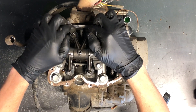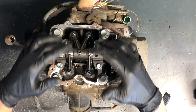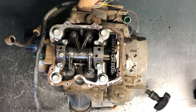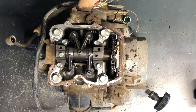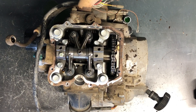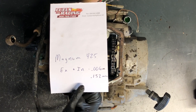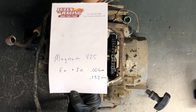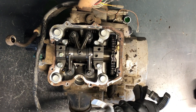If you're on the right stroke, you should have clearances on both the exhaust side and the intake side. Now we've got it to where it needs to be. You'll need a 10mm wrench. First you can check it — the specs for the Magnum 425 exhaust and intake are 0.006 inches or 0.152 millimeters.